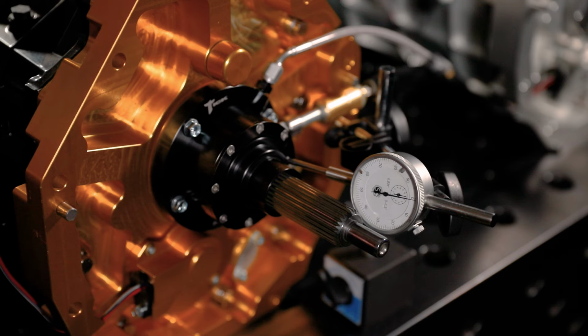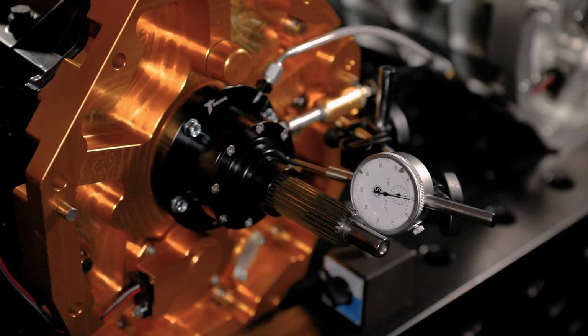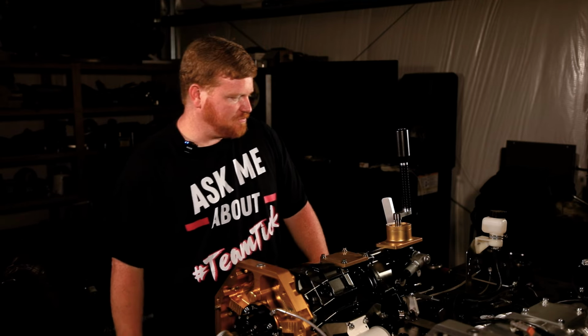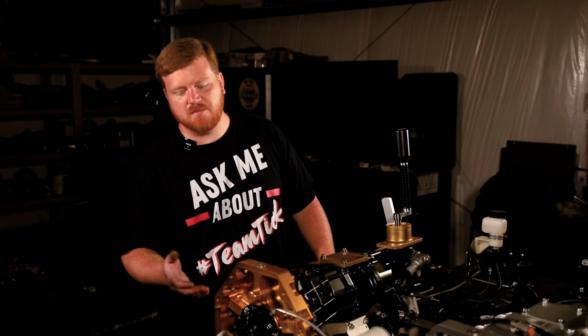So this isn't going to show exactly the amount of travel that you're going to want to see out of this. It's just to illustrate how it works, nothing more. Again, you'd want a minimum of a 7/8 bore cylinder to work this unit properly. I do have this set up to where we can use its full entire stroke range, which is 1.1 inches, and you're going to see that it moves the release bearing around 450 thousandths in this open environment.